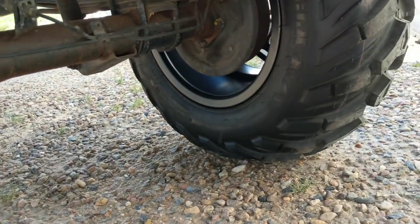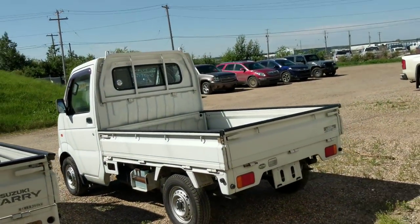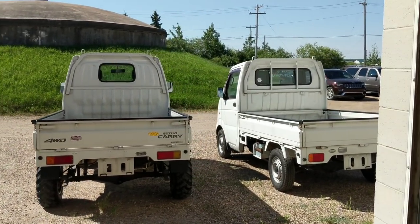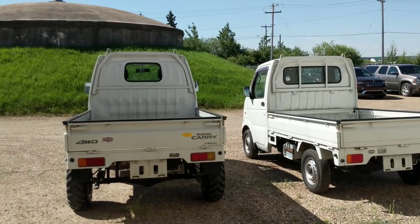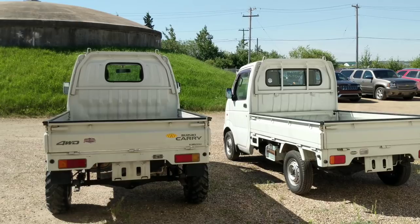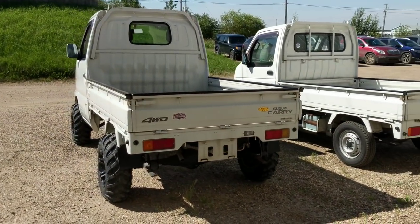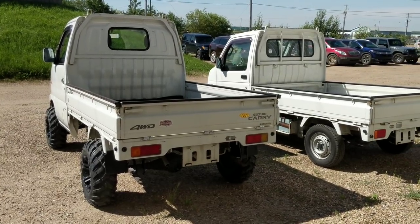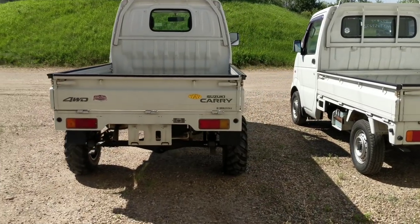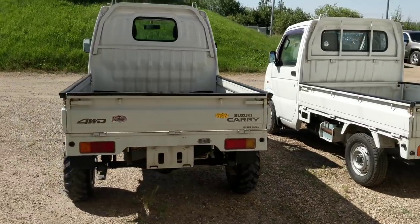All that lift at the rear is just coming from the bigger off-road tires. If you're looking to do any sort of serious off-roading you can see that stature difference from the back quite a bit — a two-inch lift and a little bigger off-road tires makes a big difference. The off-road tires run lower pressures and are wider, so you can handle softer terrain — they ride smoother off-road and definitely help out.